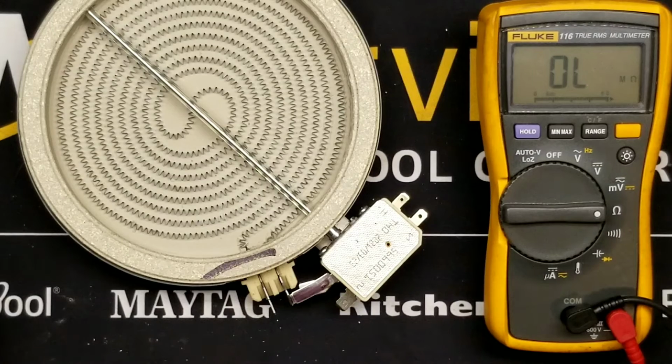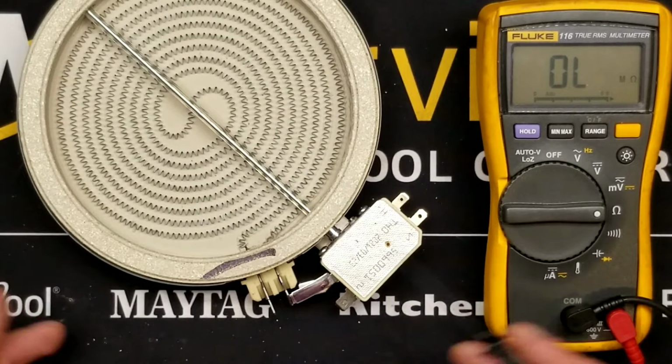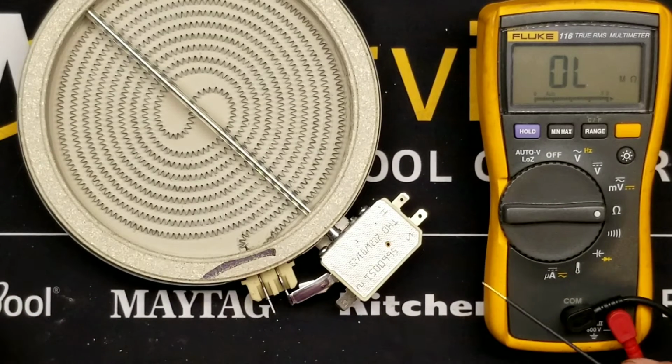So, I guess that's all there is to say. Just kidding. So, you notice one of these terminals is spot welded to this device here. So, this is a safety device. It's effectively a high limit switch, or a cutout thermostat. Just like a dryer heating element circuit, this has an intrinsic safety built in to where the wiring harness connects to one of these tabs, right here. The other one, the harness would connect here, and this puts a cutout switch in series with the element.